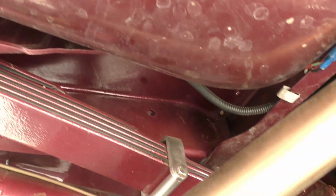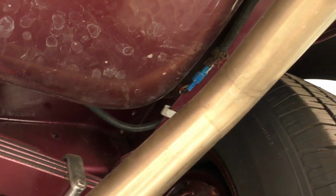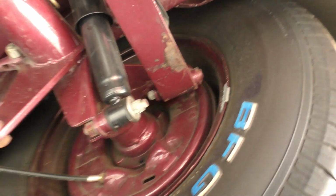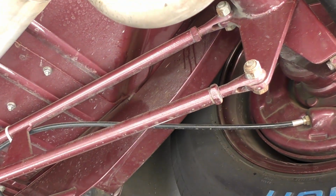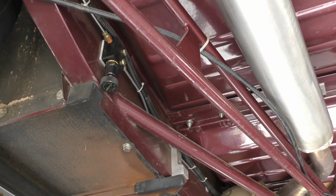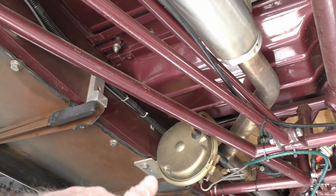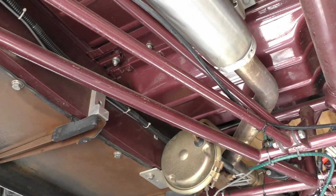This buggy spring looks like it was recently reworked. It has nylon inserts on it. There is a receipt in the file. I'm going to take a picture of that. Gas shocks, traditional ladder bar style rear suspension with the buggy spring. Brake bias is right here for setting the bias front to rear. It has a treadle vac style power brake system, vacuum power brake system.